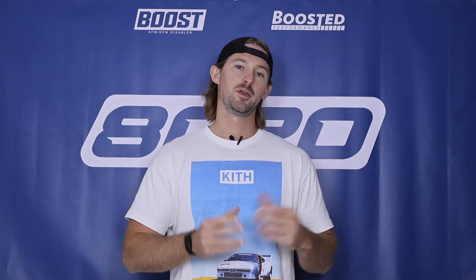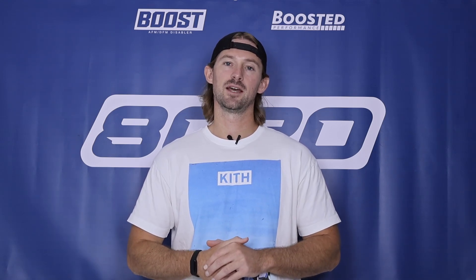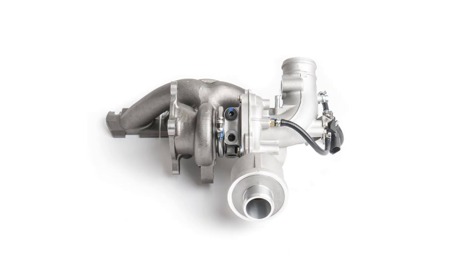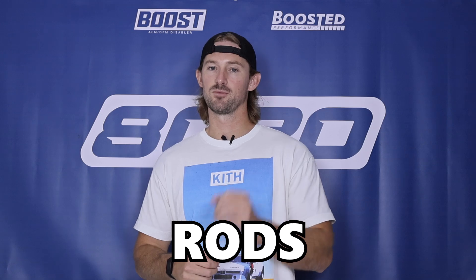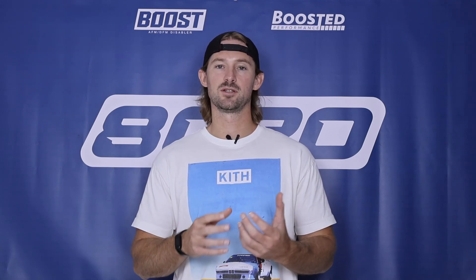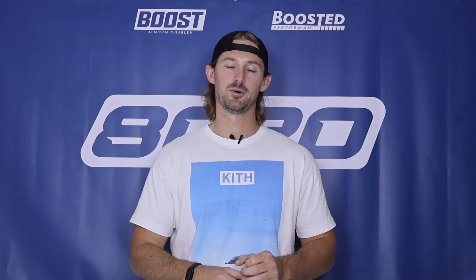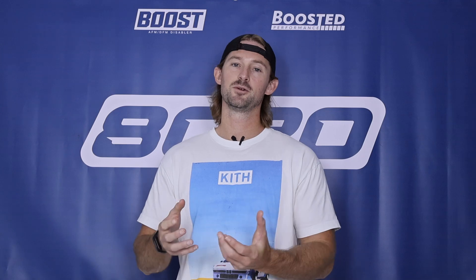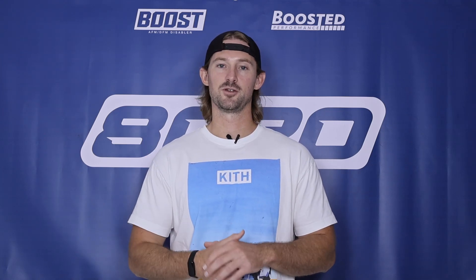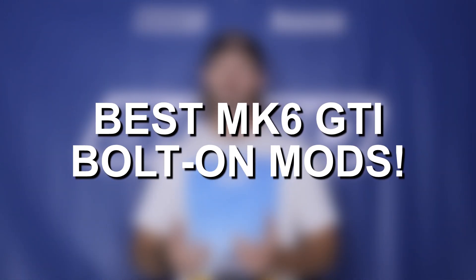Close to 300 wheel horsepower — maybe 290-ish — is about where you'll get with these bolt-on modifications. At this point, we are going to start hitting the limitations of the factory turbocharger above 300 wheel horsepower, and you'll need to either upgrade to a K04 turbo system or use a hybrid turbo setup. Once we start talking about upgrading the turbochargers, we very quickly get to the biggest power constraint on these engines, and that's the factory rods. The factory rods are torque-limited, and 350 torque is generally considered the level where you're going to start becoming susceptible to popping a rod. So ultimately, we can get to about 300 wheel horsepower with these basic bolt-on modifications, and then you can throw a turbocharger on there and get a little above that — maybe 325 wheel torque power levels.